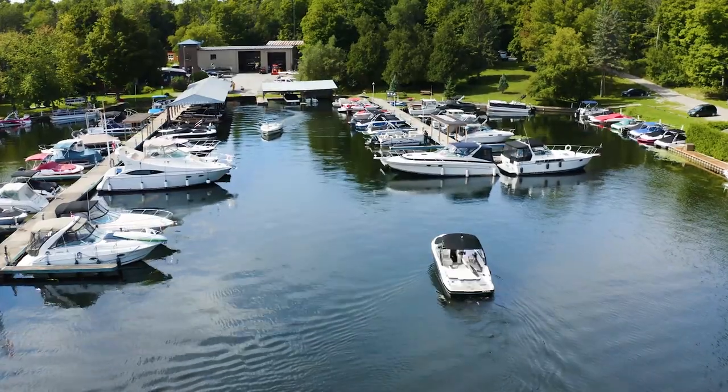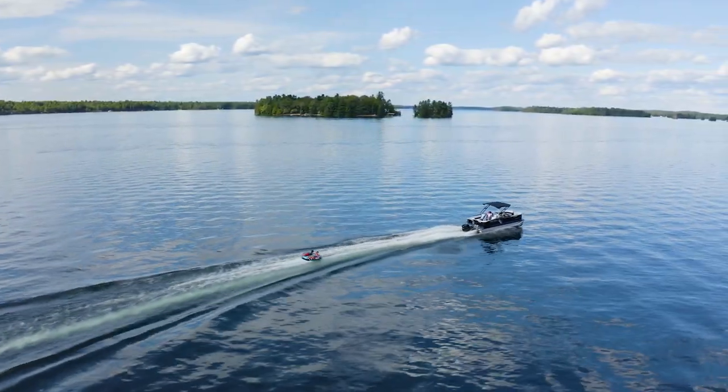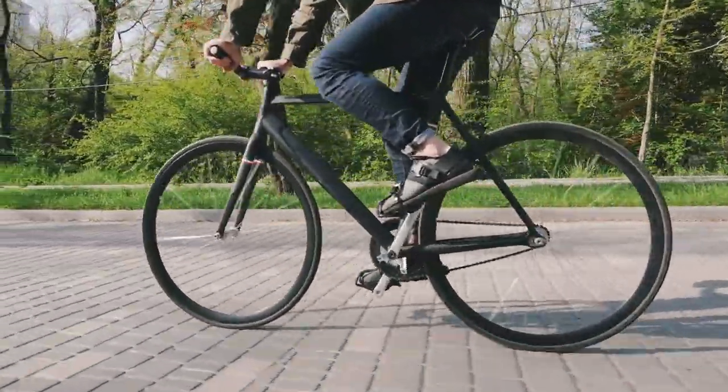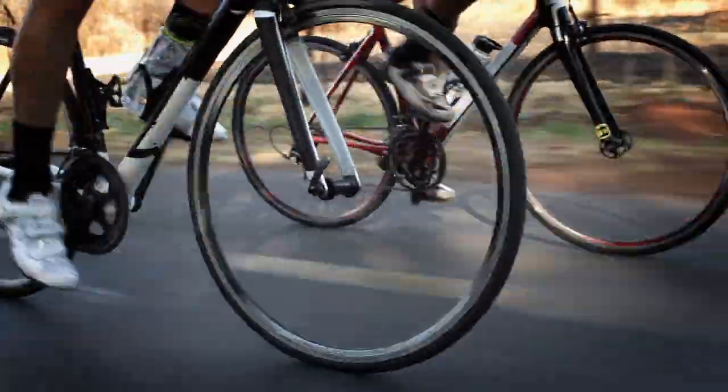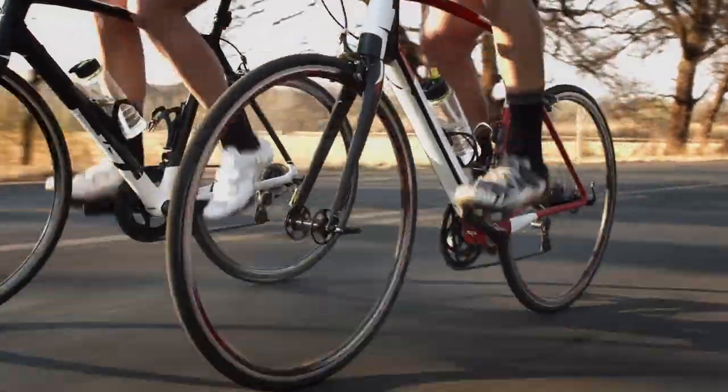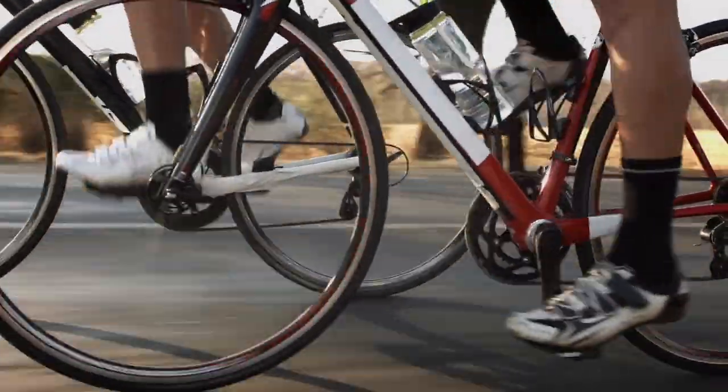What's true about boats is that there are no gears — this prop is the only gear you have. For every revolution, whether you're idling at the dock, going tubing speed, or wide open throttle, that is the gear you're driving. Think of it like a bicycle with only one speed. A tall gear, like tenth speed, is much harder to push but lets you go very fast once up to speed. A small gear, like second, is easy to accelerate but you can't go very fast because you'd be pedaling very quickly.